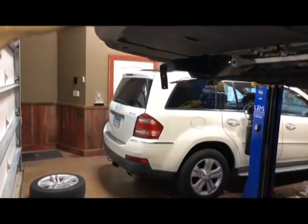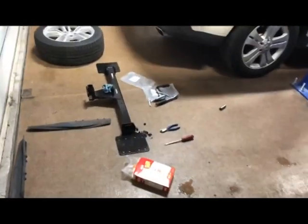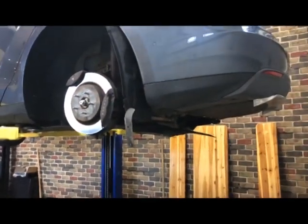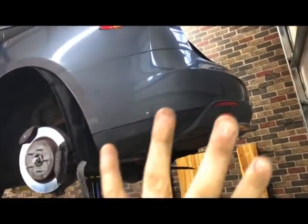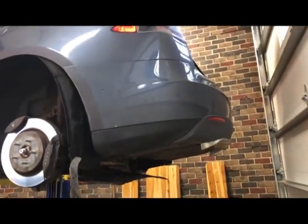That one's pulled as well. The next step is to drop the car down and pull off the lower trunk threshold and the C-pillars. Behind some foil tape there are two more 10mms, according to a YouTube video I found — I'm just telling you so you don't have to go find that same video. Then we just have to disconnect the other parking sensors; I believe there are four left. I've already disconnected the side two and the bumper should come off.